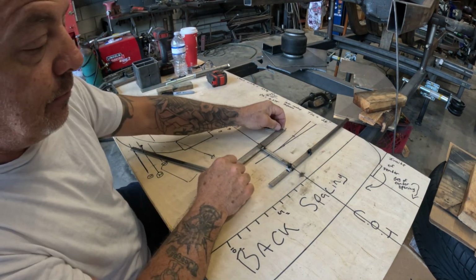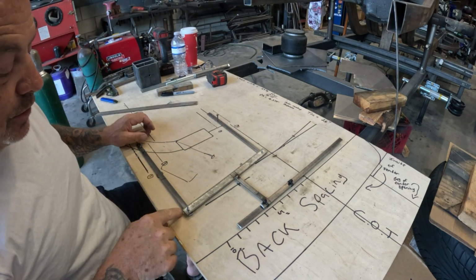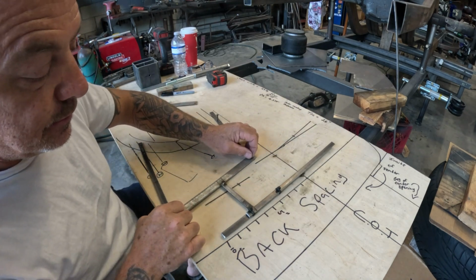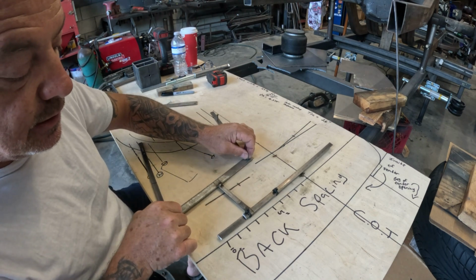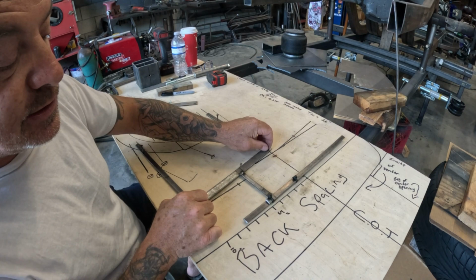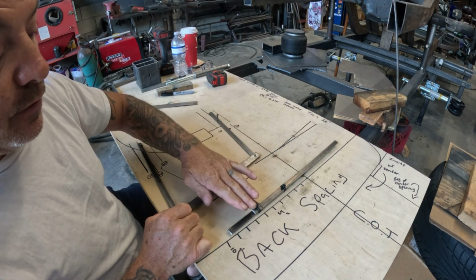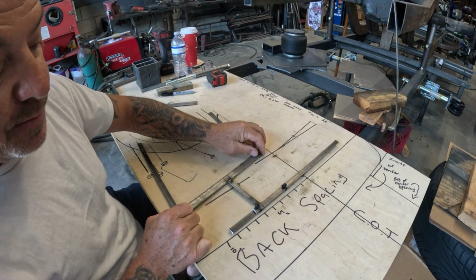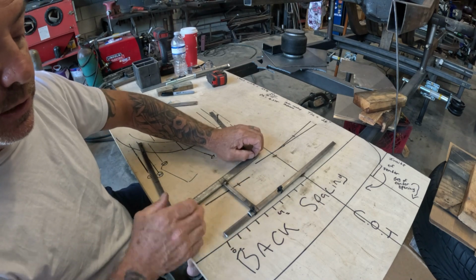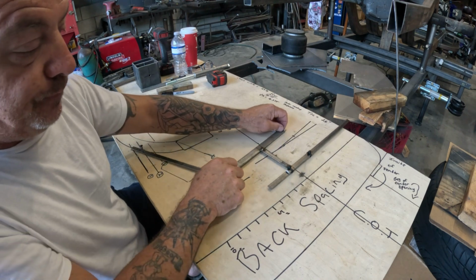Here's our bottomed out mark. 5 inches. Our control arm is parallel to the ground. And you can see that he has roughly from 4 inches to almost 7 inches of pretty steady, smooth suspension travel before the wheel starts moving in, being affected by the arc.